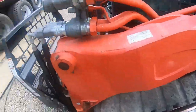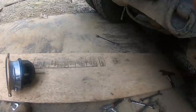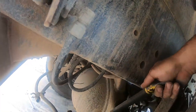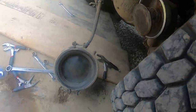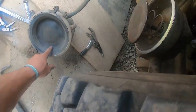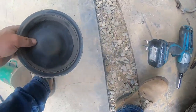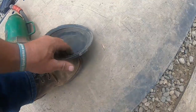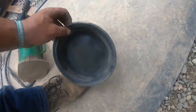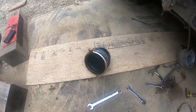Trailer's back, everything went good. I'm going to put this pancake on right now. The clamps just come off — bada boom bada bing, she's off. There's still air in there and you can see the diaphragm. This is what holds the pressure — that looks good, there's no cracks in that. Usually they're just worn out right here and blown through. That pancake's in good shape, not that we're gonna keep it because we've got a new one right there.